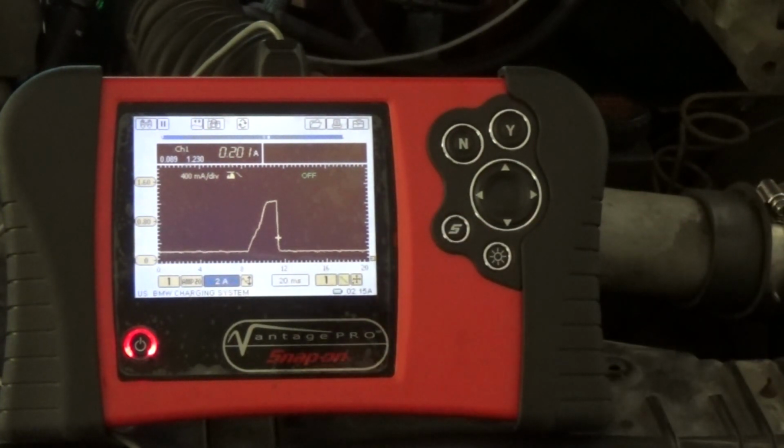It's able to provide good ground for the injector. And so all we need to do now is change the injector. Sometimes, I wouldn't say a part changer, but it's good to have a known good component you can rig into your circuit, check it real quick, and if it works, you're done. Because honestly, I really couldn't tell much looking at the current from the bad injector. It was all over the place. Otherwise you'd have to check your power, check your ground. But you can do it this way as well. Just get a current clamp and see what's happening there.